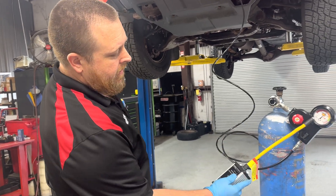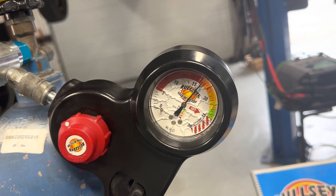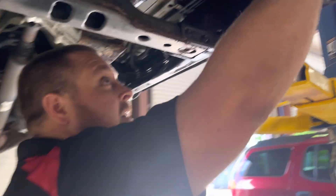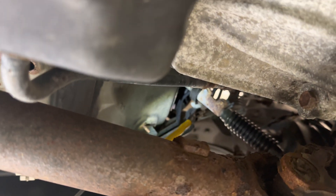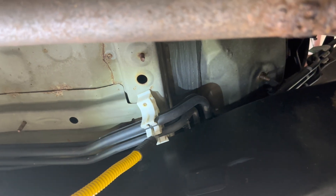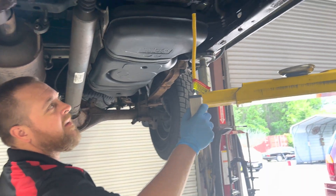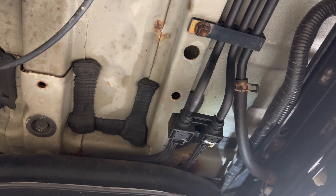Starting on low, you can see our gauge has kind of plateaued — we're still tickling in the red and orange zone, so we definitely have a leak here. Just like with AC systems, you would find all your lines and start from your entry point where the CO2 is going in. You'd want to go slowly through these lines, testing every inch of this system. The big key is to go very slow, especially on the low setting. You want to pay attention to any connection joints — they're very common to leak — and check all hoses very well.